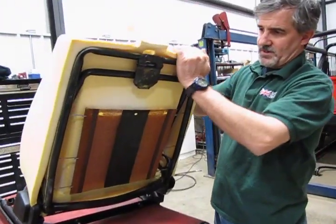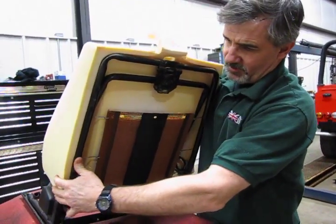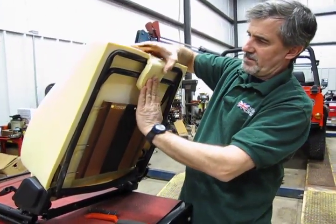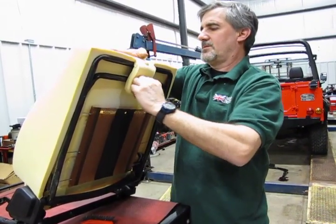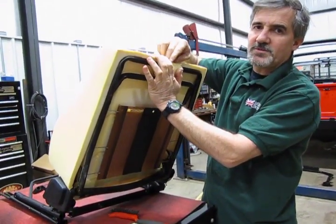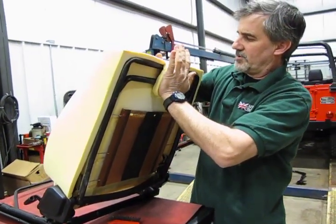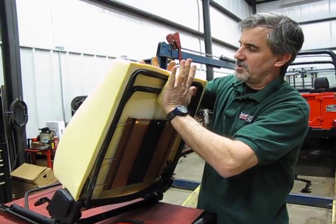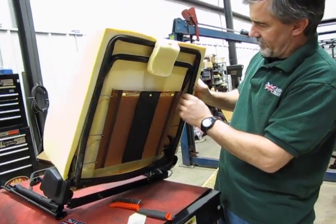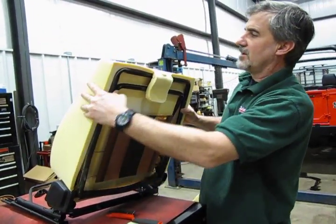You don't have to worry about this being glued solid. Gluing it down helps hold the foam in place when you go to put the outer cover on, and once the cover's in place, it isn't going anywhere anyway. Make sure your hole for the headrest is aligned in the foam with no blockage — that'll make it easier when you reinstall the headrest. This adhesive works pretty well once you give it a chance to tack up. We're going to leave this for about an hour, let the glue get good and tacky and things set up, and then we'll install the cover.